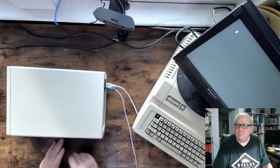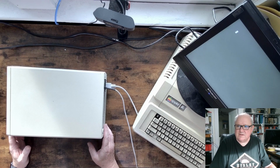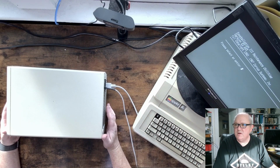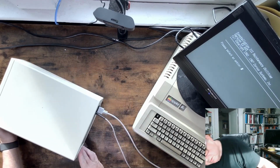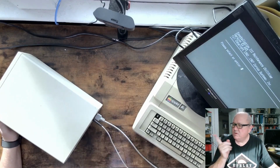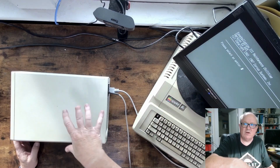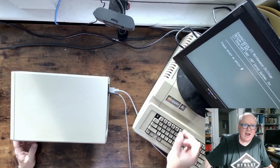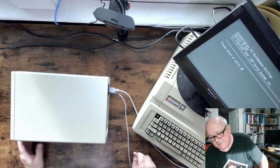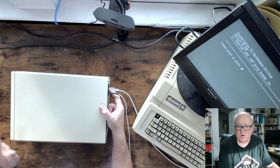And since I'm doing that, I'm loading the Corvus maintenance program. It takes a second. Interesting, the new Corvus network management utilities are all written in ProDOS, probably assembler, and it is not seeing the drive. Oh, I think I know. Yes, I was about to say the newest utilities are written and run under ProDOS, except for some of the maintenance utilities are still written under Apple Pascal, UCSD Pascal, and I hosed up the Pascal installation on this, so I'm not going to be able to use that utility. But the drive is working fine. I do need to reinstall the software on it to fix some of the problems that I'm talking about.